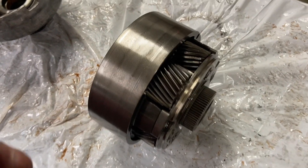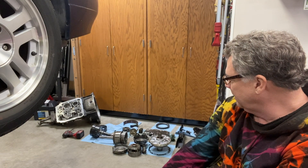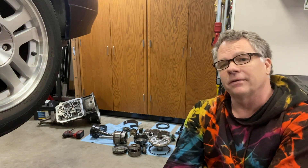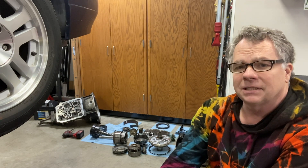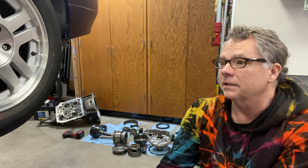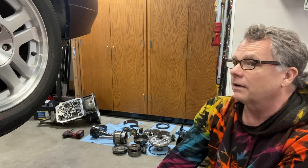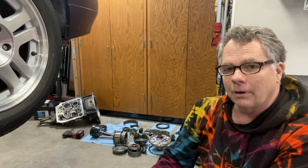I'm glad we decided to take a closer look at these planetary gears — as you can see, one of those is damaged as well. Since we found the main culprit for the problem in the transmission, I think I'll call this video quits. There's probably no point in tearing it down any further. The clutch packs, pistons, and seals are all in great shape. I'll go ahead and order the parts we need to get this transmission back up and running. While we're waiting for those parts, we'll turn our attention to the car and address other issues we found, like the brakes and the rear main seal. We'll resume the next video dealing with those issues while waiting for these parts.